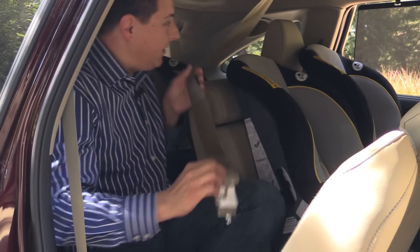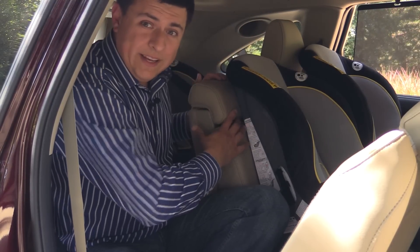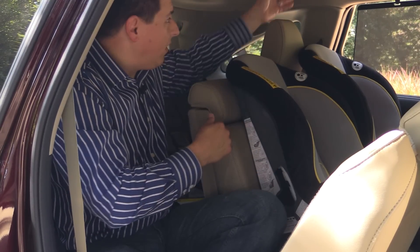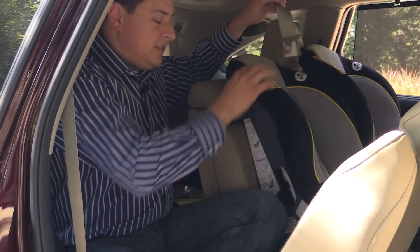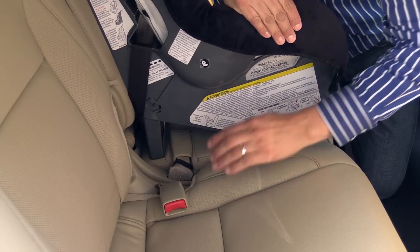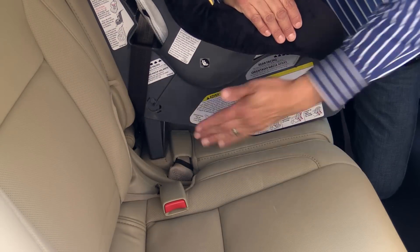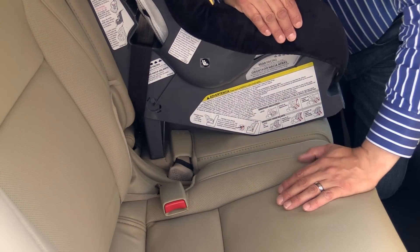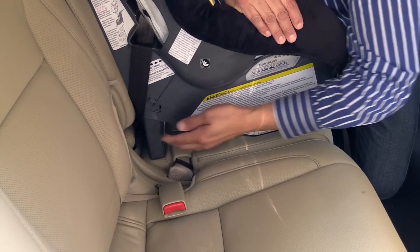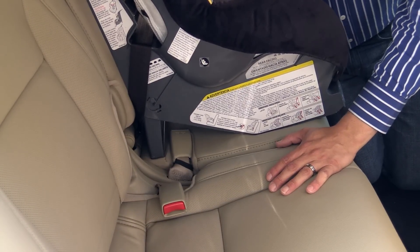The MDX uses a ceiling-mounted seat belt for the center second row seat. I find that a little bit less convenient than a seat belt integrated right into the seat, and it's definitely less convenient than this arrangement — it makes it harder to get in and out of the third row or fold the seats flat. However, that ceiling-mounted shoulder belt isn't really a problem for child seats, because we actually have a dedicated LATCH anchor for the center position in the MDX. That's very unusual because it's not required by law, and as a result there are very few vehicles that have three sets of LATCH anchors. We still have outboard LATCH anchors in the outboard seats — they're well hidden in the seat bottom cushion — but we also have center-mounted LATCH anchors as well as a top tether anchor for the center seat.